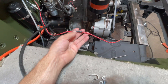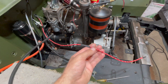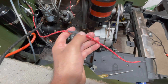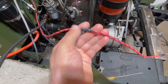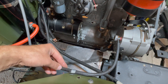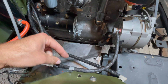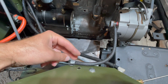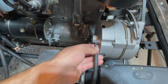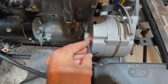Once you get your wire spliced, this is what it should look like. You have your number 7 wire coming out of your dashboard and this is your voltage regulator wire, spliced together. Heat shrink the joint to protect it and make a permanent connection. Once you have your loom installed over your wire to protect it from engine heat and debris, use a clamp to secure it to the fender, then attach the large loop to the power post on the alternator. Slide it on and put a lock washer and nut on.